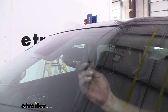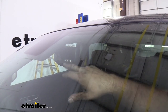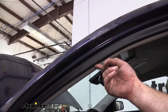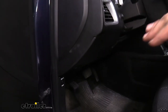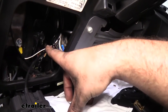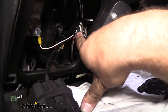The blue wire off the reed switch connects to the red wire on the indicator light, which is mounted on the mirror. That way, when towing, you can look back and see when the brakes are being applied via the bright red LEDs. The indicator light has double-sided tape that sticks well to the mirror. I ran the wires along the roof liner and tucked them into the A-pillar area by peeling back some plastic and tucking into the weather stripping. The A-pillar panel pops out so you can run wires through it, with a ground connection completed there as well.